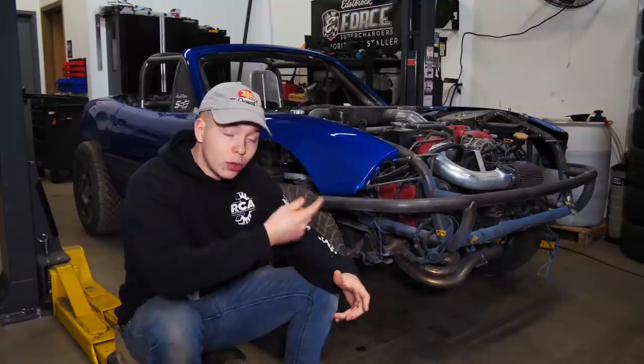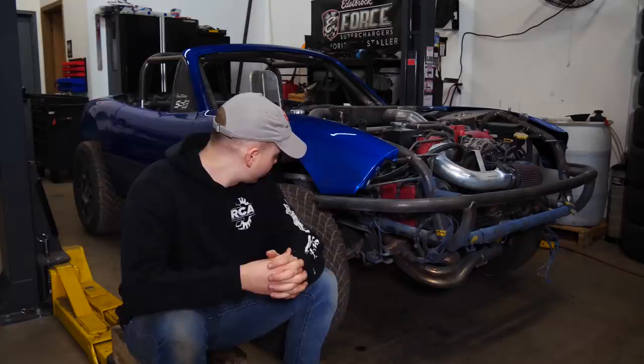So we're going to pull off all of the suspension, the rear, lower, and upper control arms, the rear subframe, the rear diff, and the front lower control arms. We're gonna put new bushings in everything, some polyurethane bushings, courtesy of Moss Miata for the rear Miata stuff, and just a Subaru parts retailer for the front Subaru stuff. Then we'll go ahead and remove all the rust off the suspension parts and paint them.